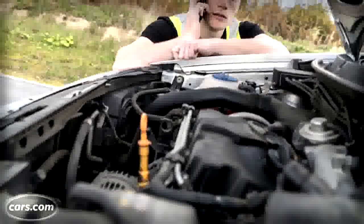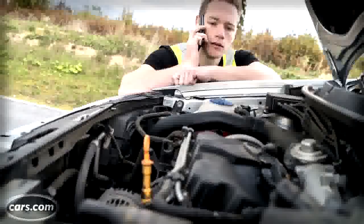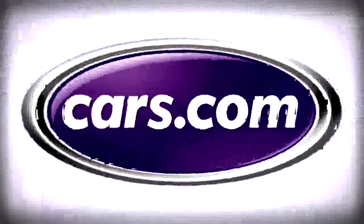You just need to know what your manufacturer recommends, and that, as always, along with the oil change intervals, is in the owner's manual. Just to give you an idea of how different they can be, there's one Hyundai model that has two different engines and two different transmissions — they're both six speeds but have very different needs in terms of the type of fluids they call for and the amount. Whether you actually replace the transmission fluid depends on what the manufacturer calls for and the condition of the fluid.